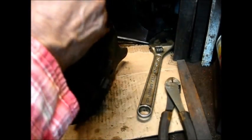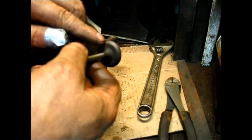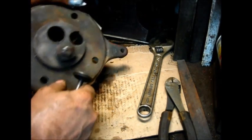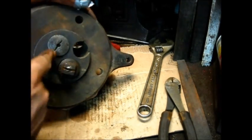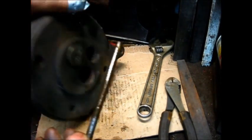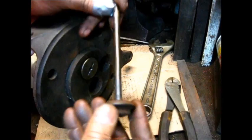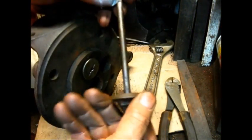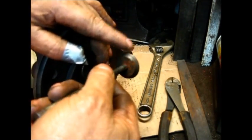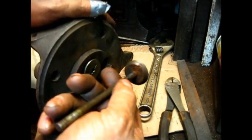This head right here on this valve looks really good. It looks like it's been hitting about halfway — it's got a little cupping. This valve will have to be faced. The seat in there, just preliminary, looks good — it'll have to have a new seat cut. Same on that one, it's a little rough but looks good as found. This valve here — I can see it's a little crooked, so I won't use this valve. The head is rounding, it's got a worn place in the middle, undercut where it's been seated with some compound too deep.